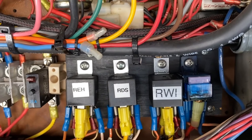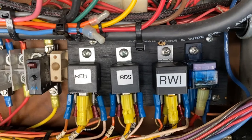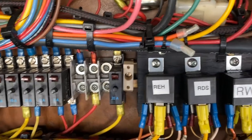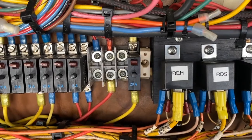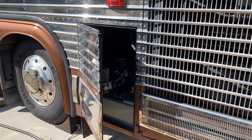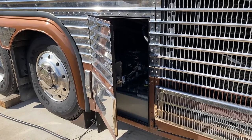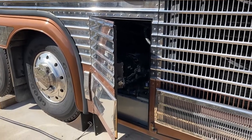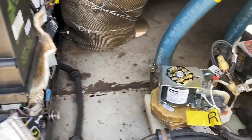If the fuse has blown, there might be something else that caused it. The relay marked WI is the one that's going to ignite the unit. The other two are relays that control solenoid valves. My Webasto is an Arctic Heat Webasto and it's inside the driver's side panel just in front of the rear radiator. Right now the unit is cycling.